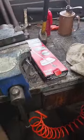And also with this dielectric grease, what I did is I put it right on the inside where that O-ring is gonna go. And right before I slip that on, I'll take a little bit of oil and rub it in here too, because that dielectric grease with oil gets extremely slippery, a lot more slippery than just putting oil in here and putting in your O-ring. That way you keep that O-ring from buckling on itself or unrolling out of the seat that it's in.